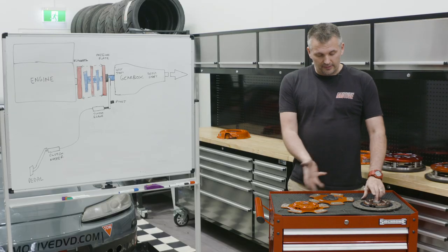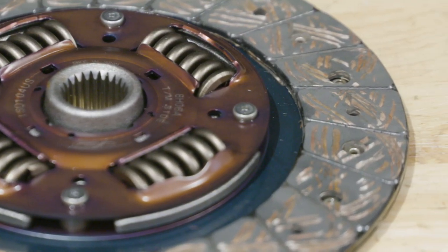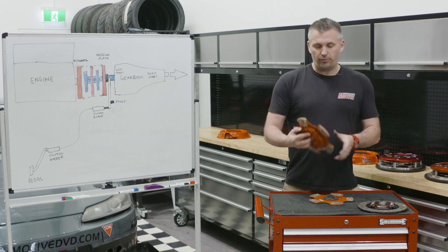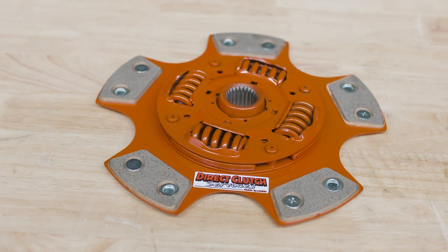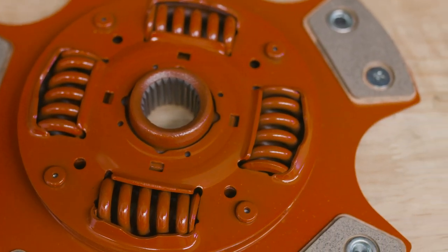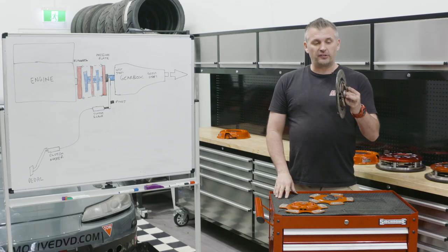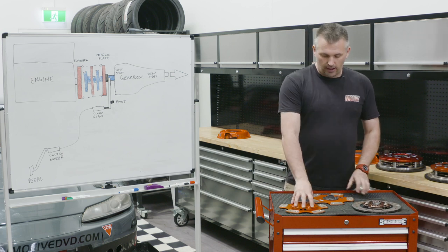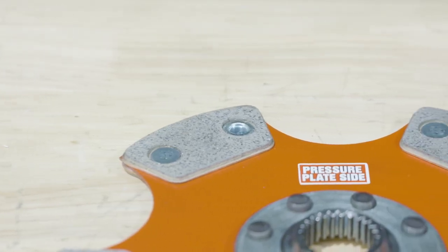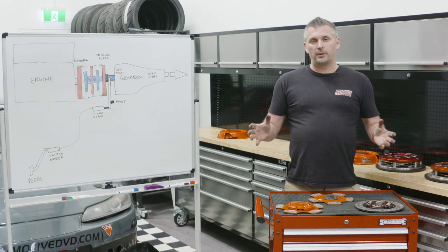Some more examples: we have three single-plate clutches here. This is a full-face organic sprung-centered — probably the best in terms of drivability. We have something like this in our WRX. If we increased the power to the point where the material couldn't handle the torque and would just overheat, we'd probably upgrade to this — a five-puck ceramic metallic sprung-centered clutch. We would want the spring center in the WRX to help soften the shock of launching and gear changes, because the drivetrain is quite weak. If we had a normal factory-style clutch in a S14 Silvia we wanted to take drifting, we wouldn't upgrade to the sprung one — we'd upgrade to a five-puck ceramic unsprung center, because the springs in the middle are often the weakest point and can break when you're being harsh on the drivetrain. So as you can see, there are lots of variables when it comes to a clutch.